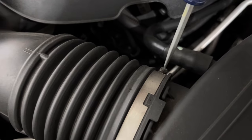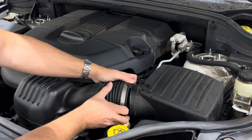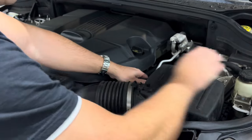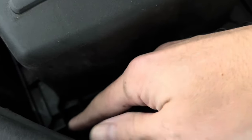For the driver's side the air filter and box need to be removed. Loosen the clamp on the intake boot with a flathead screwdriver and pull it away. Disconnect the hose — if needed, use a flathead screwdriver to carefully pry it loose.